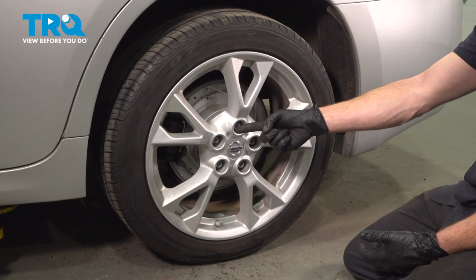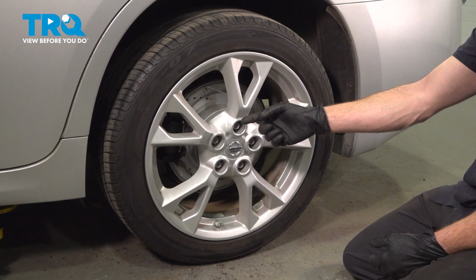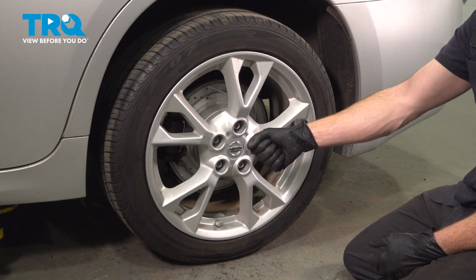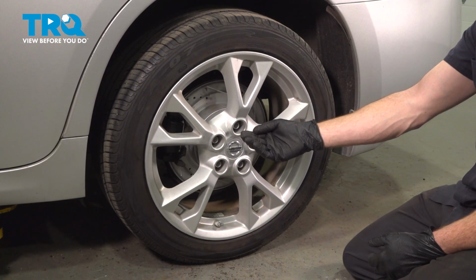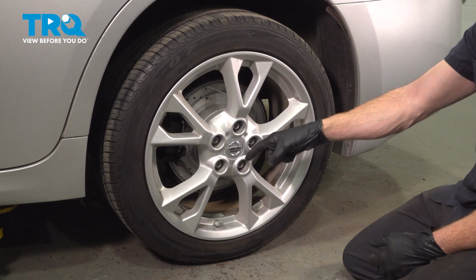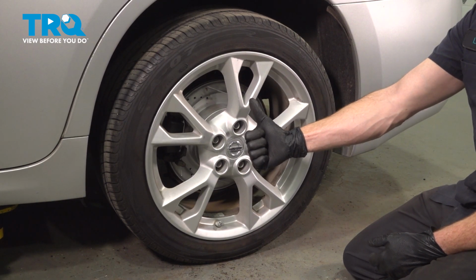Torqued. Okay, friend, we finished the installation of our rear wheel bearing. The next thing you need to do is go ahead and hop in the passenger compartment. Pump up the brake pedal till it's nice and firm. You want to take your vehicle for a road test. Make sure you don't hear any odd noises coming from this area, and definitely no ABS light. Aside from that, thanks for watching.